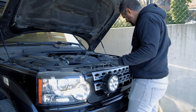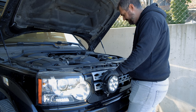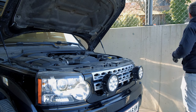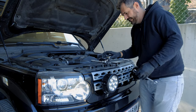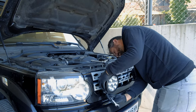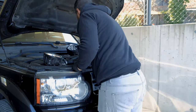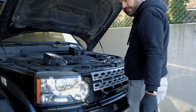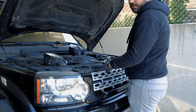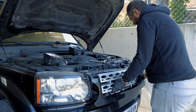Now I have to remove the front grille. I think I can do this while sleeping because I've done it several times now. Let's go and get the additional headlights off and then get the grille off. For those who haven't seen this before, you have to push down these four clips up here and then pull it out — but it isn't so easy to remove the grille.